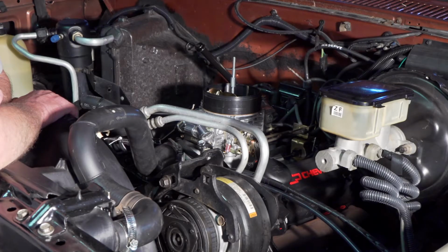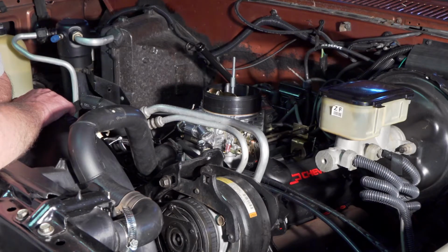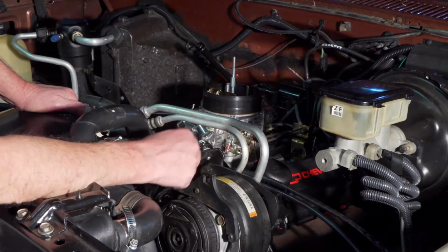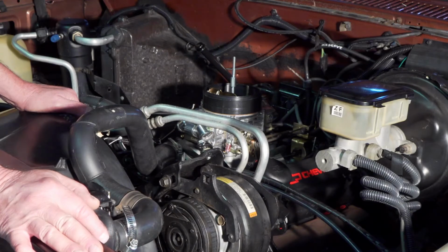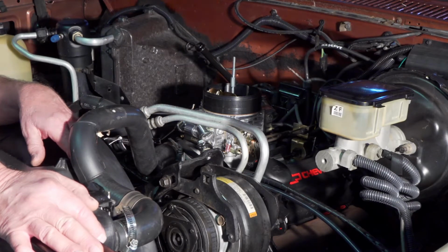The coolant system seemed to be running hot in my first video. And what I did was I just simply went out and bought a $19 water temperature gauge, mounted that on the dashboard, and I pulled the electric one out of the block, and I put in the probe for the little copper tubing. It seems like a pretty accurate temperature gauge. So instead of running 210 degrees, it's showing about 180 to 190 degrees.